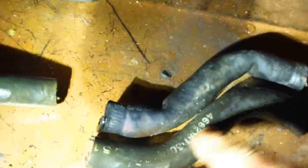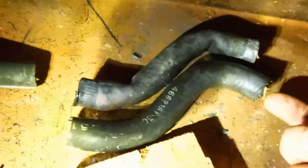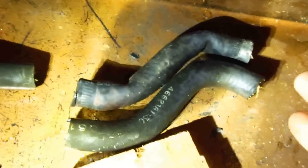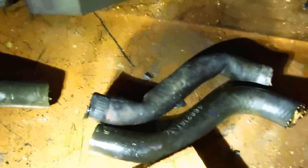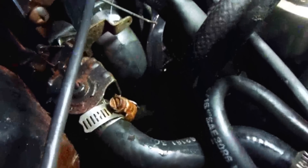Here's the piece I cut — you can see it's a molded hose with no kinks in it. I'm going to wash it out with some vinegar before I put it on to make sure there's no rust inside where it needs to seal. I don't want rust under the rubber — I want pure rubber going over the fitting so it grips good and seals good. This is the hose I just made from that other piece of heater hose — the molded portion means no kinks. This should provide very good heat.